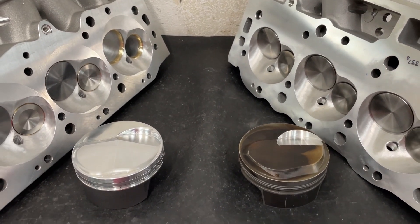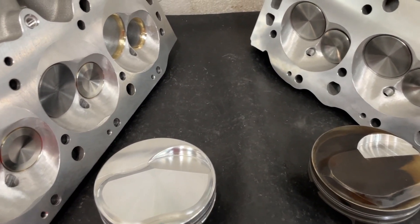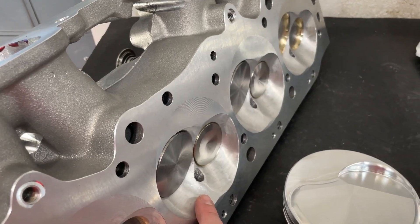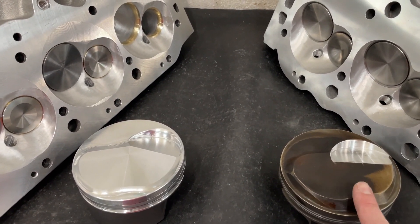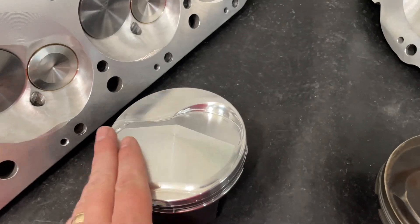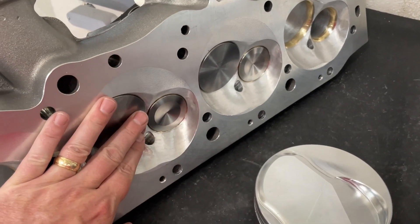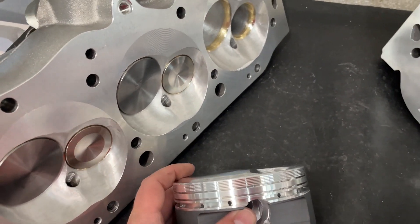Here's something to think about: the larger the cubic inch, the less dome you need to get to the compression ratio you want. So obviously a 540 versus 582 — the 540 is going to take more dome to get the same compression ratio as the bigger engine. However, with conventional heads being 119 cc — considerably larger than this BRX chamber — you have to run a much larger dome to get to the compression ratio. With the BRX on a 582 at 106 cc chambers, that's all the dome you need for 11.2 to 1. If I hadn't softened the chambers, they'd be about 97 cc's and the dome would probably be gone altogether — a flat-top piston on a 582, which is pretty outstanding.